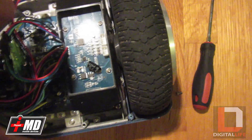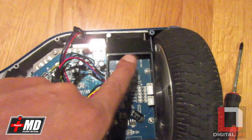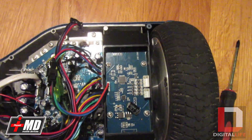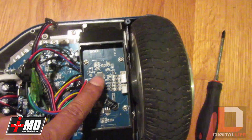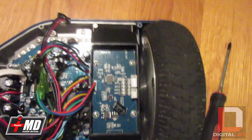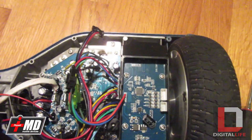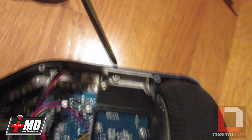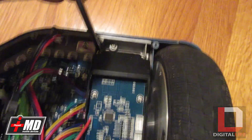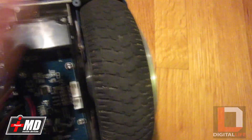The main issue is right here — we need to pull this out. This covers the two foot pedals, front and back. The problem is a sensor that's not reading the infrared signal, kind of like a garage door opener where something is in the way. This board is damaged and needs to be replaced. Use a Phillips screwdriver to remove the screws and pull the pads off.